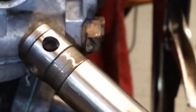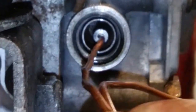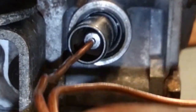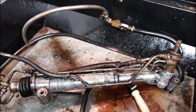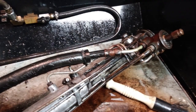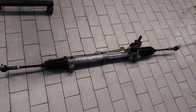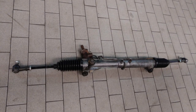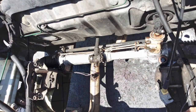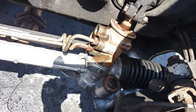This is what lack of oil changes would do to your engine. All engines have a system very similar to this built into the oil pump, and it shows the importance of keeping the lubrication system clean with fresh oil. While the engine was out of the car I decided to remove the steering rack to tidy it up. The rack was very dirty and the tie rods were loose and wobbly and needed replacement. I took it to the parts washer and washed off 30 years of oil, dirt, and grime. Once cleaned, I installed new inner tie rods, boots, and outer tie rods. I had initially planned to fully disassemble the rack and install a reseal kit, but I noticed the oily mess came from the front crank seal and the oil pump seal, not the rack, so I left it alone. It will be removed again and get a complete reseal at a later date.